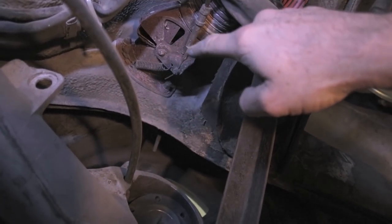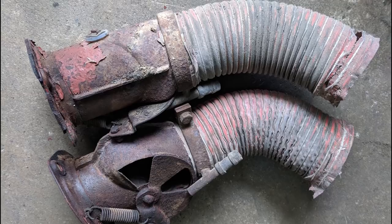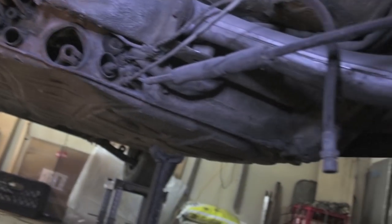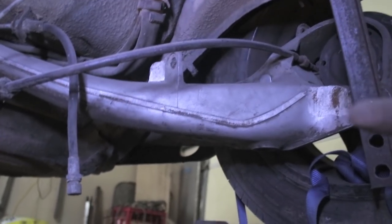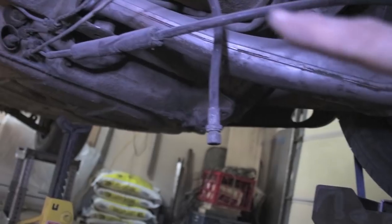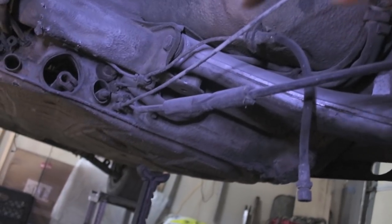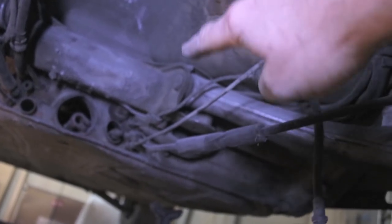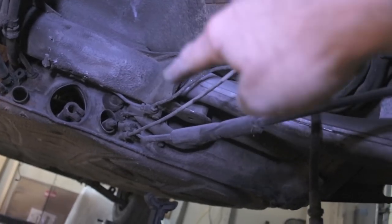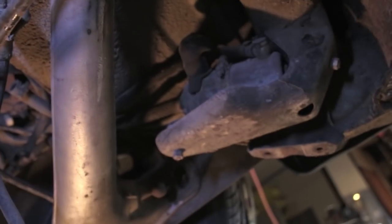To get started I'm going to remove these heater valves — they're all rusty anyways. Item five, six, or seven on the list is to reinforce the torsion bar. You can see where the trailing arms attach to the rear torsion bar. As you're making a corner there's a tremendous amount of force that gets translated along the bar, which tends to take this torsion tube and push it into the car. The goal, and what they did in the previous race cars, is to tie this torsion tube to the actual body using some plates — just a simple plate that goes from this attachment here on the torsion bar up to the body, and it strengthens things a little bit.